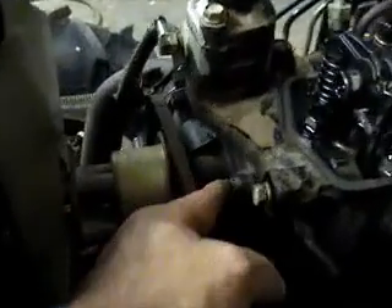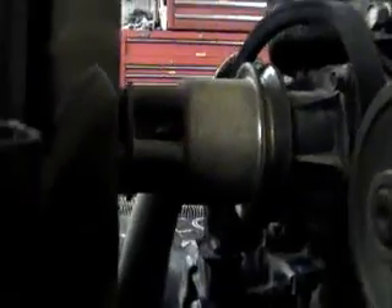I can't remember — I don't think you have to take either one of those water pump bolts off. I think I did last time and then realized I didn't have to, because they do not go into the head at all. The water pump actually runs off the block.